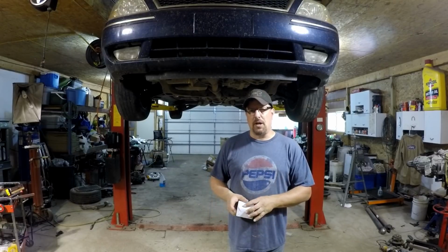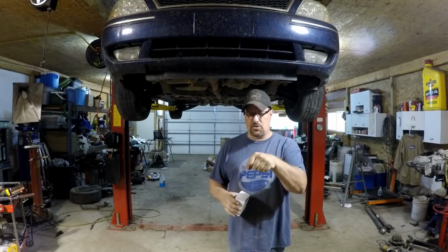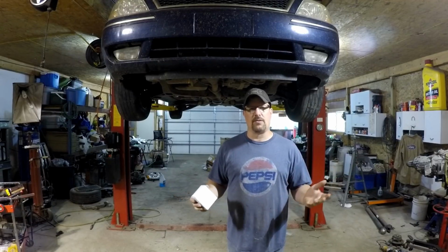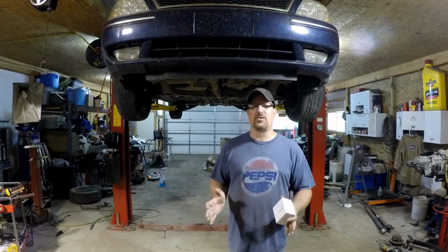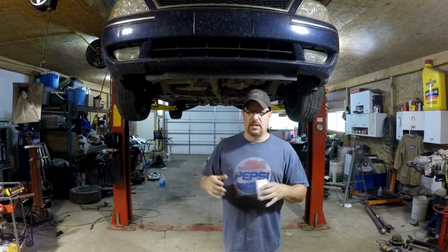That being said, it's kind of a double-edged sword, because a couple of the vehicles I've worked on, I've actually got the vehicle to track straight with a straight steering wheel. And I tell the people, you got to get a wheel alignment, and then they don't get an alignment. Six months later, their tires are bald because their alignment was off. And they tell me, it didn't need one, it drove great. Well, it doesn't matter how it drives, it still needs one. So if the steering wheel is a little bit off, I'm not too worried about it, because that kind of reinforces the mindset to the owner of the vehicle, like, hey, we've got to get this vehicle into an alignment shop, get it done correctly.